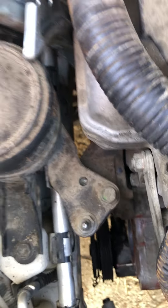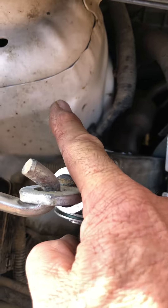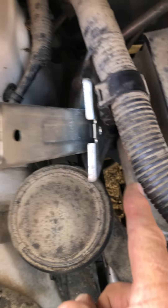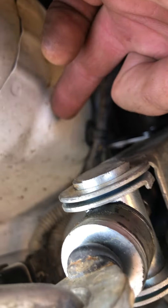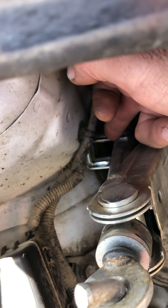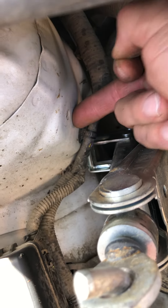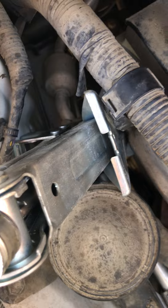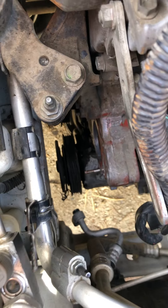The way to do it is to take a jack. At the top of the engine there's the oil cover and the body at the back. I put my jack in carefully, resting it on the oil cover plate and against the body. The part that goes under the car has a small square piece that fits against the body, and then against the engine. I just cranked it gently a couple of times to give me enough room.